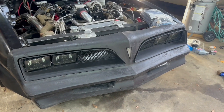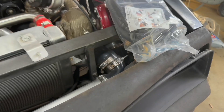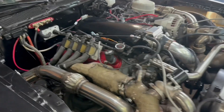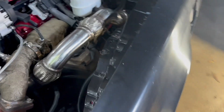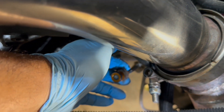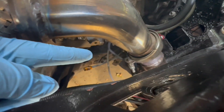It's not 100% complete — the front end conversion — but it's in place. Need to notch some here so it accepts the whole piece, or change the way that coupler routes. Engine's running pretty damn good now. I'm gonna tie up some loose ends. I was working on the clutch connection, but this is a quick connection and the piece that goes on is threaded. I checked my box — the other piece that goes to the threaded part to connect to this one did not come with it.